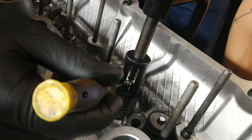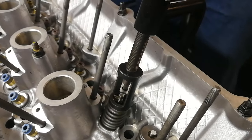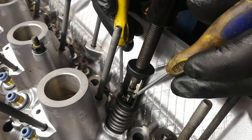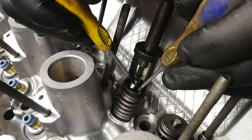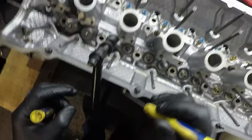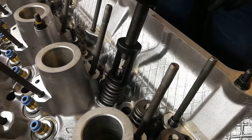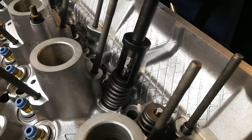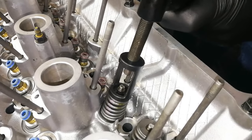I'm going to gently hold the collet, try to get in there, place it against the valve, stabilize it with my finger, and grab my screwdriver to play around with it and get it to sit where I want it. There we go — he's in place. I'll grab the next collet out of the pot of thinners. The first one's relatively easy, the next one is always a bit trickier — my shaky hands really don't help. There we go, right — we've got them both in place. The grease is holding them on the valve, nice and tight against the top.